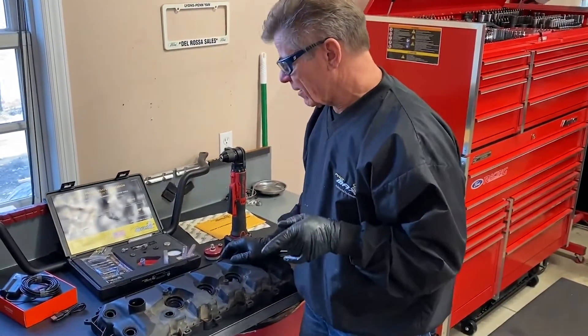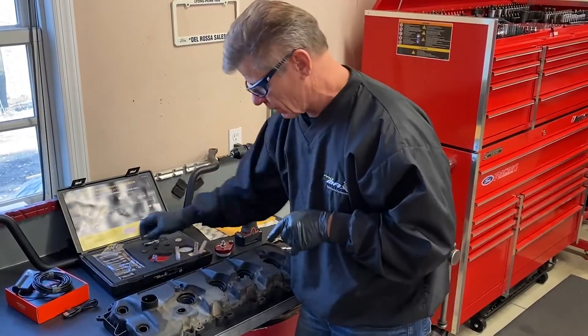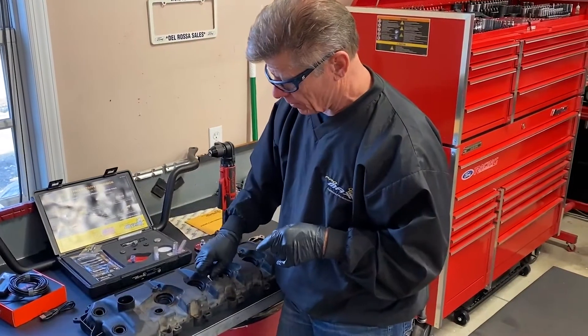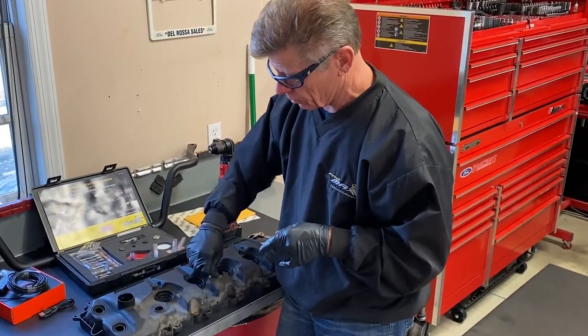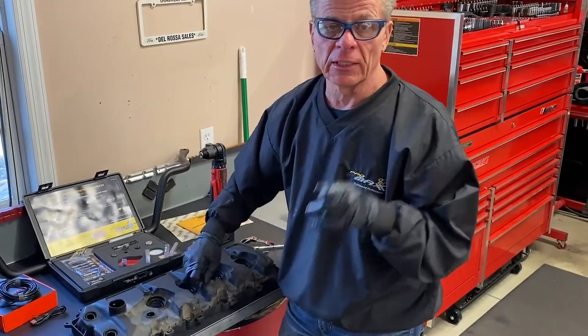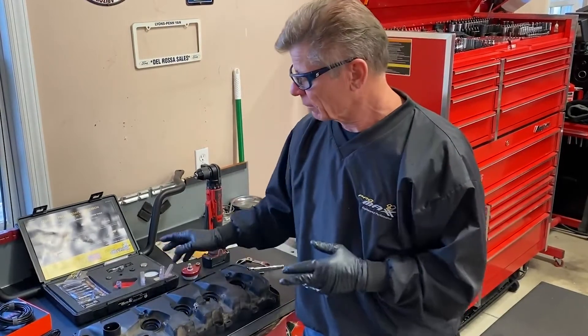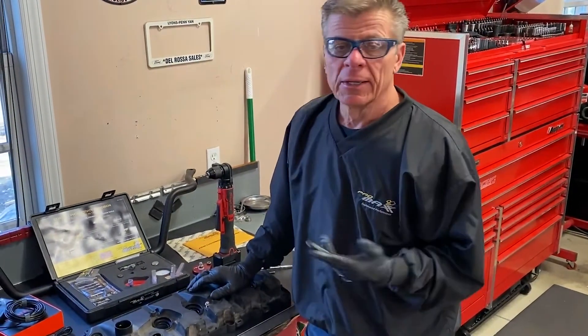I now have my hold-down bolt repaired. I drilled it out, and now I'm ready for the ignition coil to be put back in. Of course, I have my 6mm 125 bolt — it'll go right in there nicely and fix it up. It's really slick and easy. You can see it took less than 15 minutes: set up the jig, drop it in, drill it, tap it, and you're done.